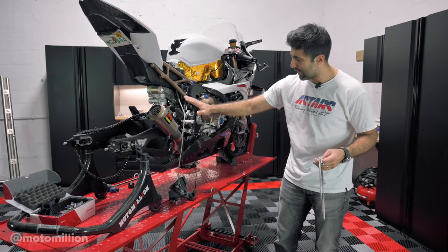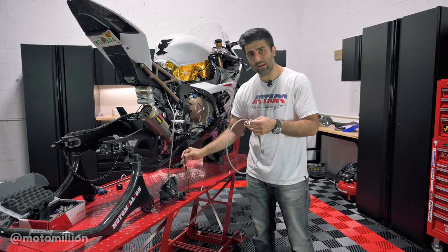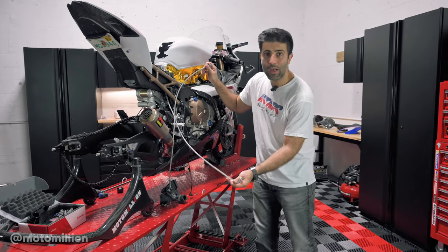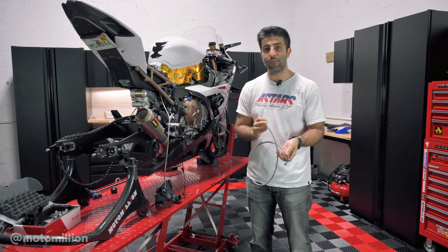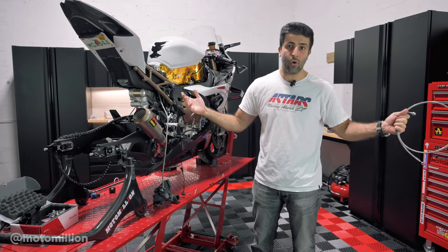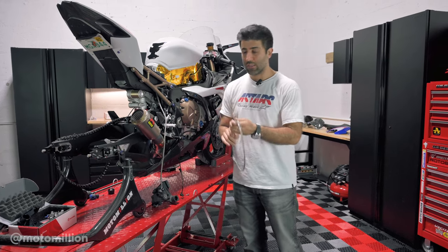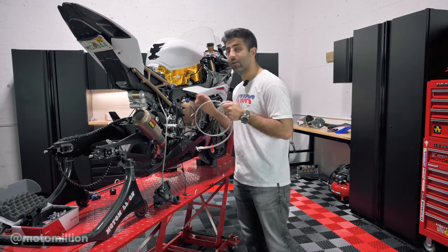Michael freed up the brake line and also the ABS sensor — be careful with this, put it aside. This is the brake line that comes in the kit and it matches the stock line pretty well. There's also a shorter line you can get when you order the product — it's for the ABS delete, so if you have a bike that you're tracking or you just want to delete your ABS, this underslung kit is also available for that. Let's get to installing the caliper and everything, and then we'll move on to the front of the bike.